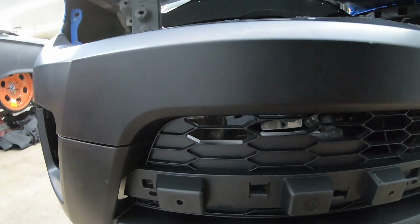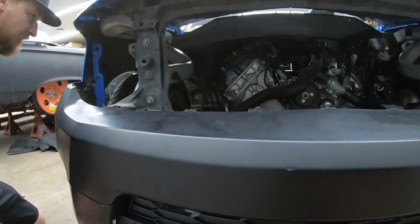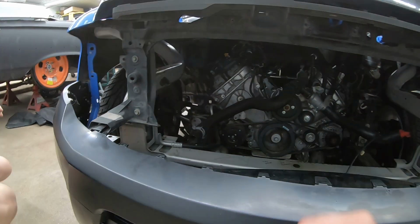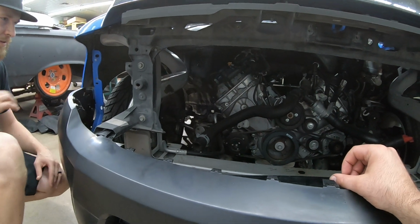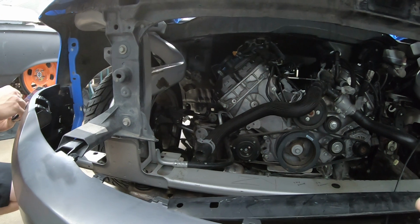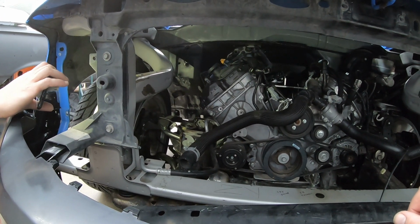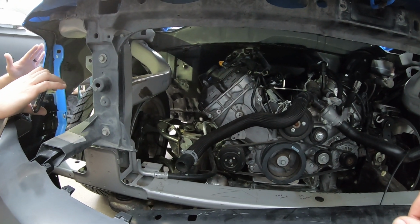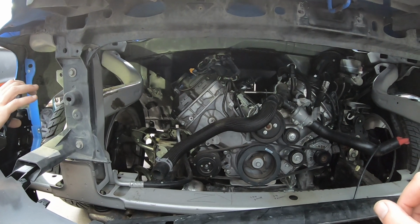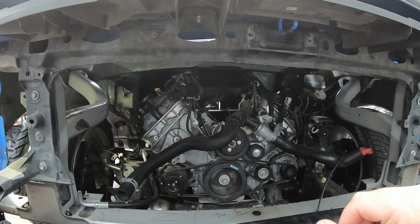Did you move your control arm pockets out some? No. It looked like there's welding right there. No, but I did spray a bunch of degreaser and stuff, so it pulled a lot of the coating off. I'm kind of surprised, I know you haven't done alignment on it, but I'm surprised that the cam bolts are that far in. Yeah, it's actually pretty cambered in too. It's been on and off a few times, so I just left it alone.